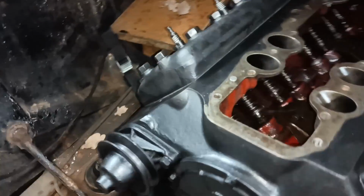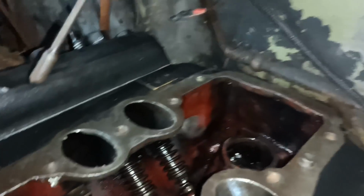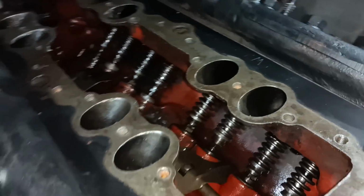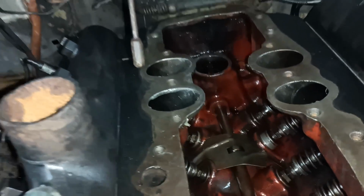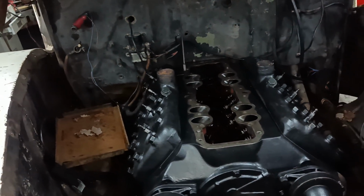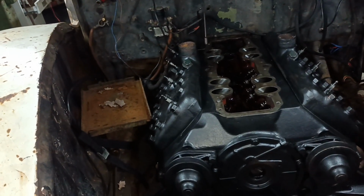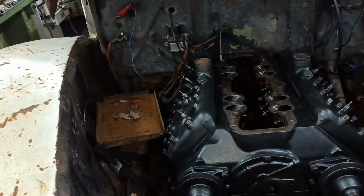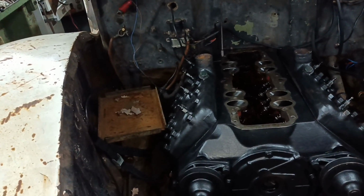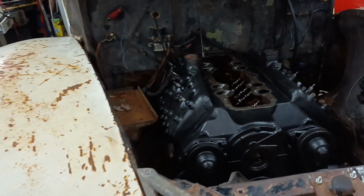So I'm going to do a sanity check, check down all the ports, and I will at least place the inlet manifold back on top. I'm going to check down all them ports, make sure they're all clear, check in there, make sure that's all clear. I sometimes put a magnet in there, but I just haven't got one to hand at the moment. But no, it's in. This is a 255 cubic inch motor plus 30 plus one at 60, so God knows what that makes.